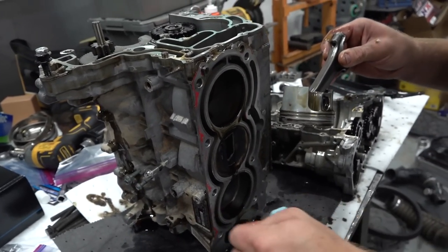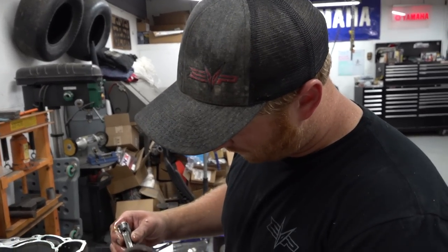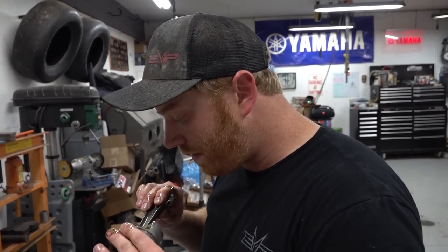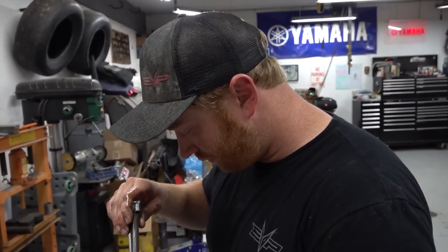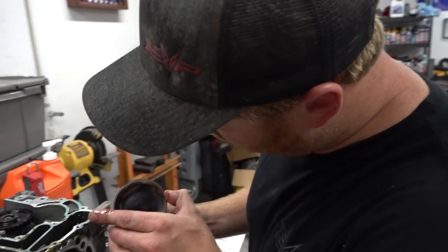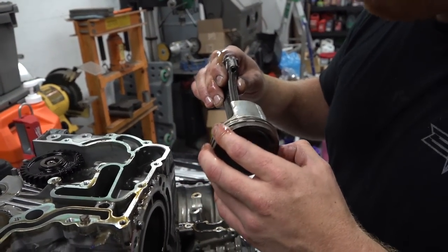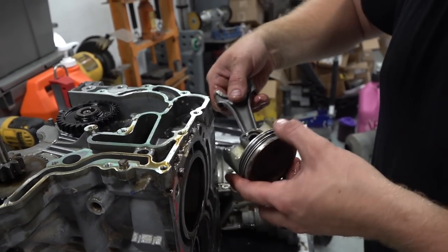So yeah, there is a scratch in one of the cylinders. I think we're just going to hone it and send it. With an infinite amount of time, maybe we would repair it, but the sucker's got a race, so it is what it is. Overall, 2 out of 3 is not bad. Doesn't look bad, man. You got any skirt marks? No, I mean, there's some on them, but in general, in pretty good shape.